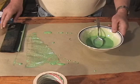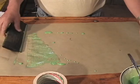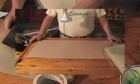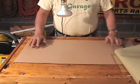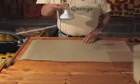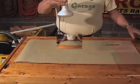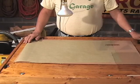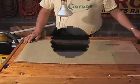We need to now clean up our materials before the photo emulsion turns into the rubbery mix it does. The photo emulsion has been drying now for about 5 hours. We put a nice flat sheet of plexiglass on the table so we have a nice flat surface. And we've hung a photo flood bulb above the work area. Now we need to turn the lights off at Vintage Garage, get out our screen with the emulsion on it, bring it over to the table, set it under the photo flood bulb, and do our exposure.